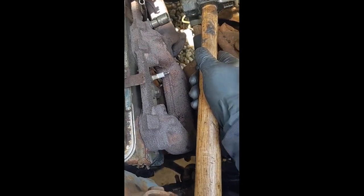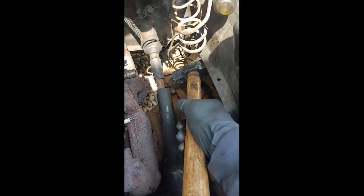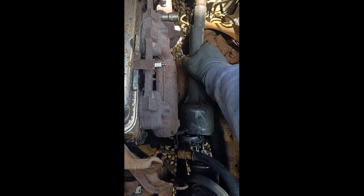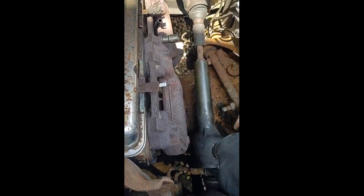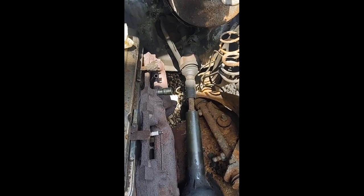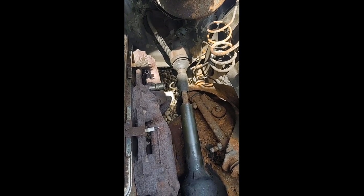These are bolts I had to remove since I need the manifolds off, but they're messed up. I'm hammering on a smaller socket with the shaft in the way. Just to let you know — first of all, your steering box had a ton of play. There's an adjustment I did. But this thing here, there's a rubber piece called a rag joint, and it is destroyed — it moves way too much. That's what was causing that rubbery feel in your wheel.